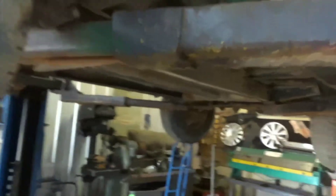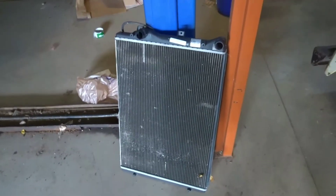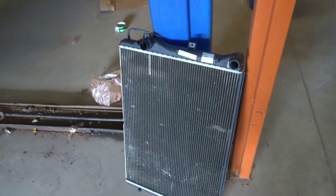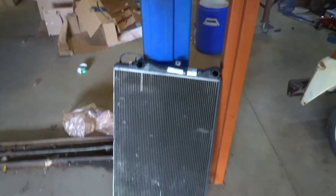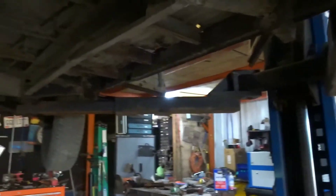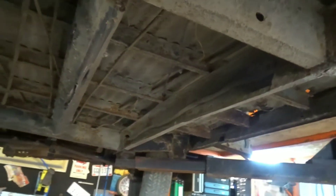I just want to show what's happening radiator-wise. This is a radiator from a 2006 through 2010 turbo Jetta — a Jetta GLI or GTI. Going with this because I figure if it keeps a turbo car cool it should work pretty well here. I'll add cooling fans since it's going to be mounted up under the frame rails. The other reason is I have about five of them, so we'll go with that and hope for the best. If it ends up not being big enough I'll switch it out.